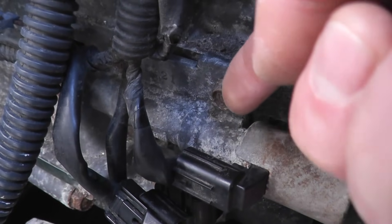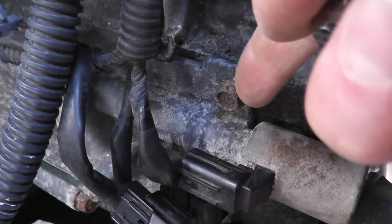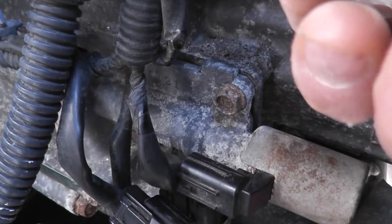When reinstalling the fasteners, you don't need to over-torque them — they're only around nine to ten foot-pounds from the factory, so just give it a good snug. As you can see, testing this valve is quite simple. All of these tests can be done while it's still attached to the transmission. If this helped you and you're looking for other transmission videos, I'll include a playlist. Thank you for watching — we'll see you next time.